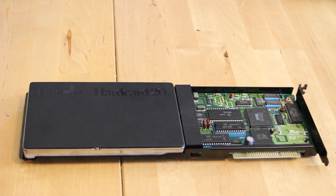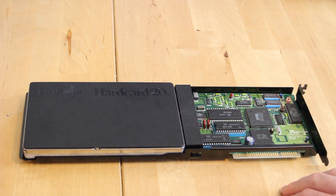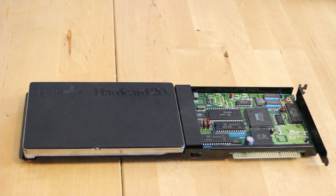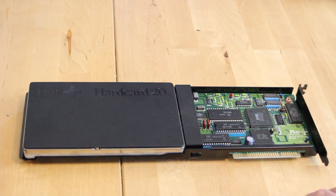For example, it sticks sometimes when you start it up — it's the actual platters that are sticking rather than the heads. You have to take it out and give it a wiggle, as Adrian Black shows on his channel, to try and shift the platters around just slightly to unstick them. Then you can put it back in the machine and it should spin up. I also partitioned and formatted it when it was quite warm, so it doesn't boot from cold — you have to wait until it's warmed up. Presumably something is changing size as it heats up, so there's probably nothing I can do about that. I'm not going to open this today, especially since it still works. I use it in my IBM PC with the XT supply.